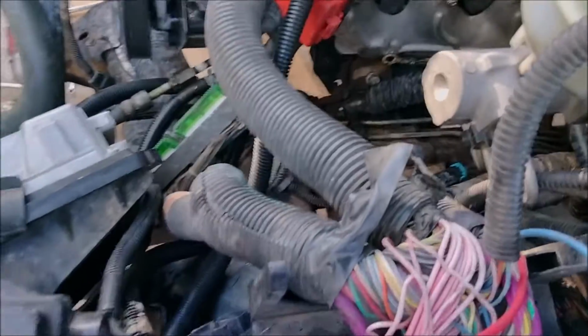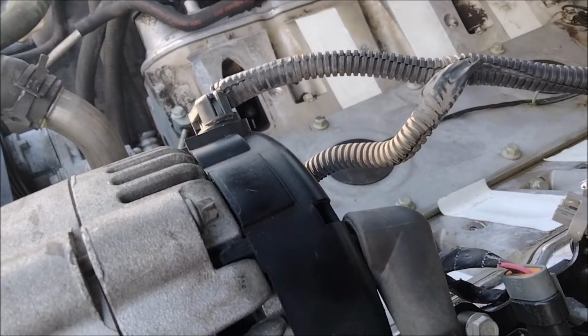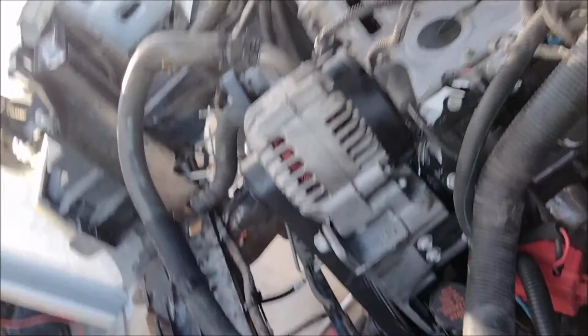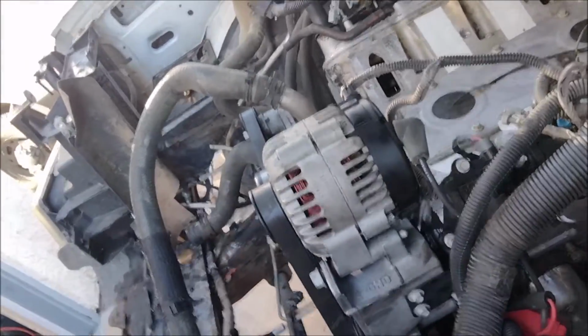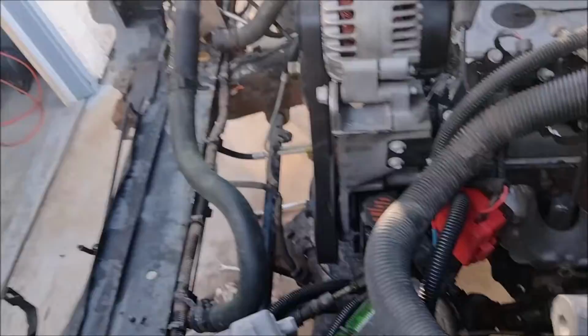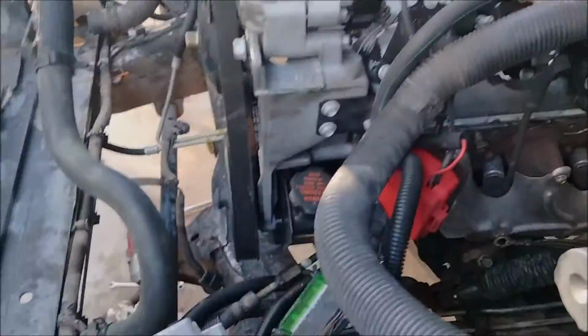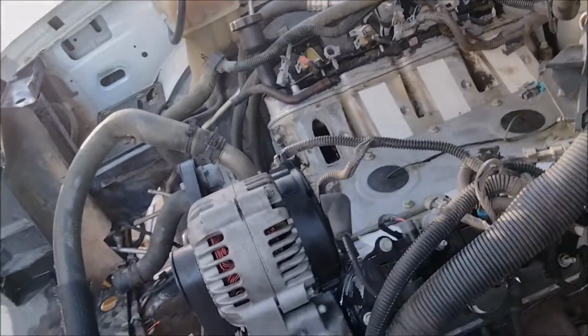So I've got to hook that up, and then the usual power. This harness had the older style voltage-regulated alternator. It has that thing on the negative battery cable that has a plug. So that's great for me because I don't have to change the alternator, but I also have to make sure the tune matches that. I'll cover that when I go over the tuning stuff. The other thing I've got to hook up is the TPS and the IAC because I'm making this a drive-by-cable setup. So I'll do that when I'm doing the fan stuff.